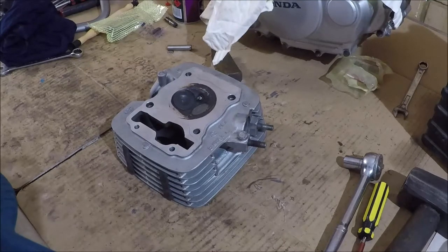Now I guess it depends on why you pulled your engine apart in the first place as to whether you need to do this. Bob is really more of a low-end sort of rebuild. We've re-ringed and re-pistoned an existing bore, cleaned out a bottom end, and replaced a few bearings. This is not what you'd consider to be reconditioning, I guess.